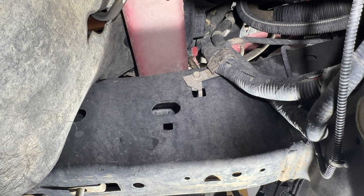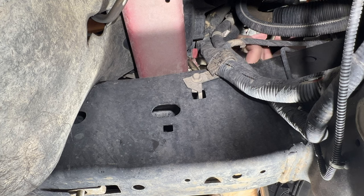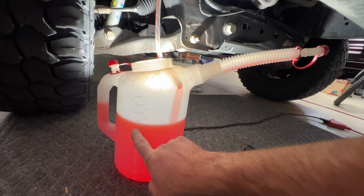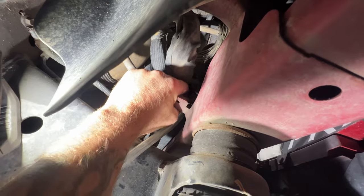Take this down into my clean container. To get that drain plug loose you're going to use a flathead screwdriver — just reach up in here and get on that plug. It'll start flowing out of there. I'm not going to pull it all the way out, just loosen it up enough to get it flowing. I'm going to call that about good on the coolant — you can see this is the quart mark and I've drained about four and a half quarts out of it, so I think that's plenty. Go ahead and close up the drain valve.